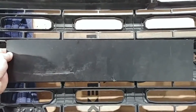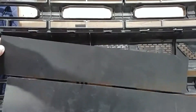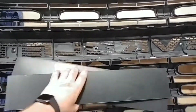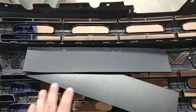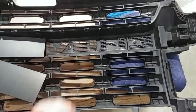I'm going to go with either something a little bit more recessed, something like this, or drop it down a little bit further in there. I'll show you what I end up doing. I'm going to be mounting some amber lights to the back of this panel and then the panel acts as a light stop. We fill it all in and make sure that no light gets through so we don't have any orange light on the other sides of the grille. That's how we're going to end up backlighting only the logo.